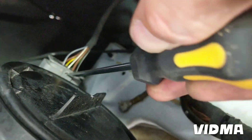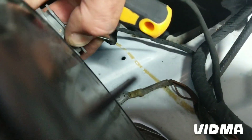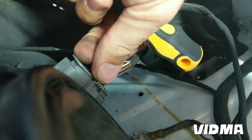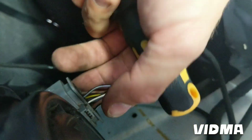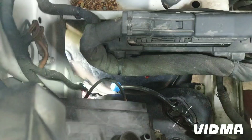Another thing — how to get this connection off. Basically take a screwdriver in there, turn it a little so this slides out, then push it down. If this guy is in there you're not going to be able to get it out any other way. I practiced on this light first because this one had less room.